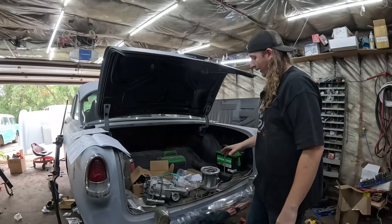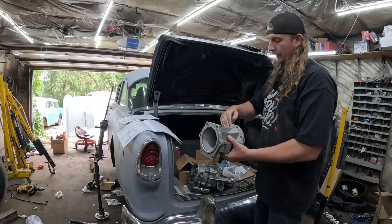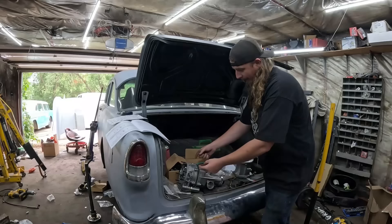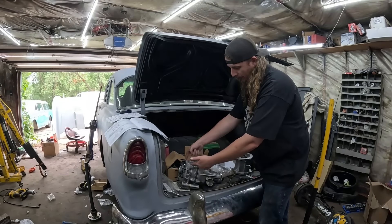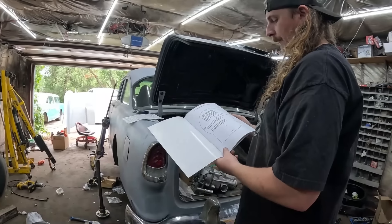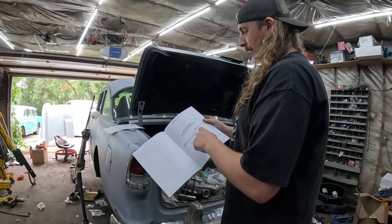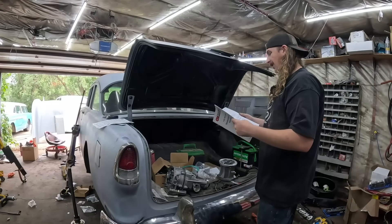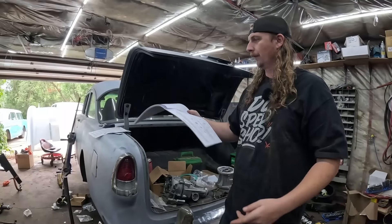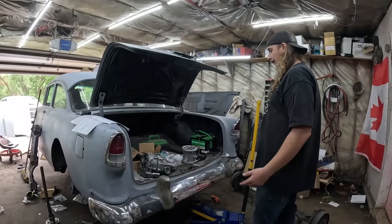This way, this will fit for sure without any modification — it'll be able to go this way, but we're just having to deal with this section. This is still got to be 30 pounds or something like that. Looking at it, it obviously has a couple of high spots here so we may have to dint the floor a little. The instructions are very simple. It comes with templates which you can cut out if you want. You center it to your transmission and that gives you an idea. John actually said he had a bunch of these made out of aluminum that we could borrow, but instead we're just going to jam it together and hope for the best. So I'm going to get under there, pull the tail shaft off, let it puke transmission oil on the ground, and lie in transmission oil for the rest of the day.